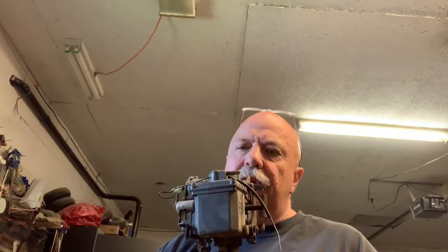What happened after a bit of time is that they had probably wrestled and fought with it for I don't know how long, but they actually got a pile of fuel. Now, maybe the float is stuck in here, and I haven't pulled the carburetor apart yet, but I need to do that before I put it all back together. I will be doing a carb job on this, and I'm going to see why the gas was just pouring into there.